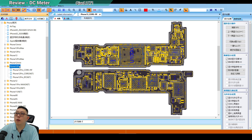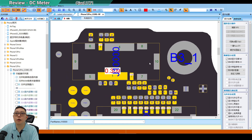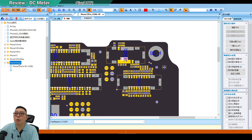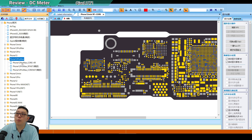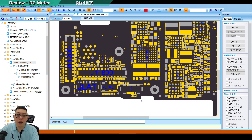In case you don't know why the iPhone 12 Pro Max is different: on the iPhone 12 Pro or 12 Mini, look at the battery connector — the gray ground is on the outside of the board, and the positive is on the inside. But on the 12 Pro Max, the ground is on the inside of the board and the positive faces the outside. So if you plug in the wrong connector, it will definitely short. This is why a separate connector is needed.